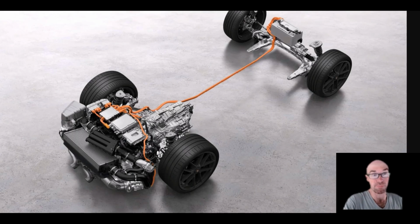But the total output here is a lot more, 64 more horsepower, in fact. And the torque actually isn't that much more. It's not as much as you would expect, even though they say the electric motor alone gives you 110 more pound-feet of torque. That's because the electric motor produces most of its power at a very low RPM, so the overall rating doesn't reflect it that much. But in the real world, if you get on throttle, especially at a lower RPM, the power is going to be right there instantaneously. This is always the nice benefit.